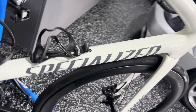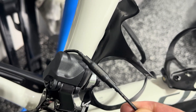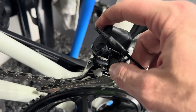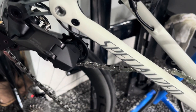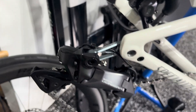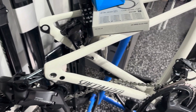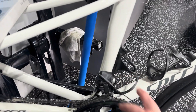And then you're going to use the Shimano EWJC302, which is this here. You're going to connect that, which is going to be connected to the battery and which connects to the mainframe here — the computer at the end of the derailleur. So you have to create a closed circuit and then you're able to individually update each side here using the cable.